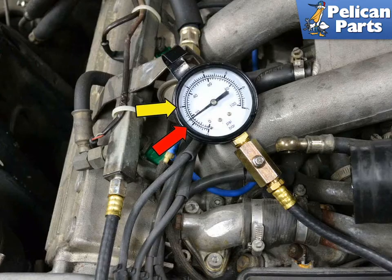You also want to check your leak-down pressure. Stop the motor and let it sit for 20 minutes, then check the static pressure. You should have 2 bar of pressure, plus or minus 0.2 bar, on all 8-valve motors, and 3 bars of pressure, plus or minus 0.2 bars, on all 16-valve motors. Anything substantially less could be a problem with your check valve, and result in poor hot start or vapor lock problems.